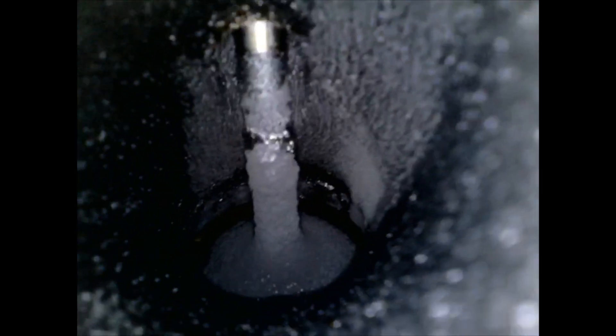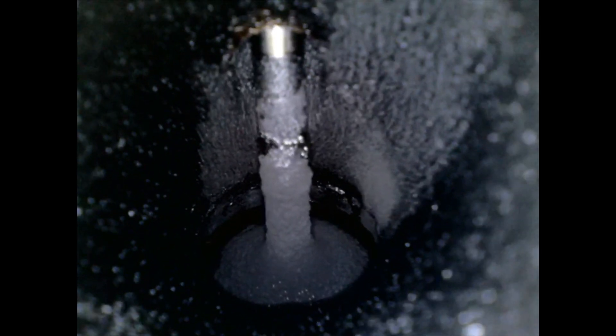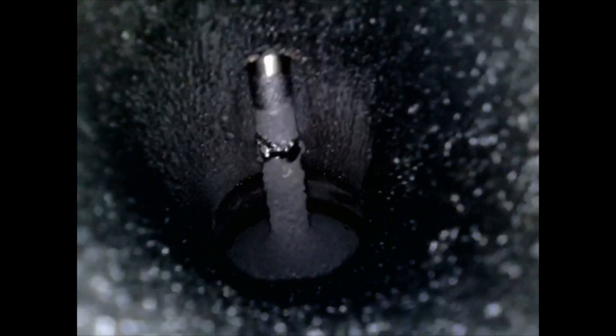Here's the left hand side. We've got a similar build up, and the airflow really needs to be hitting a radius, a really nice curve of the valve stem, but it's actually being disrupted badly because it's hitting an irregular pattern. This is cylinder number two where you can see there's a shiny part of the valve visible at the top — that's how it should be, and that's the radius I refer to. The airflow should be hitting that but it's not, so we're going to do some walnut blasting to sort this out.